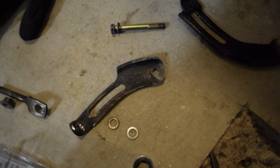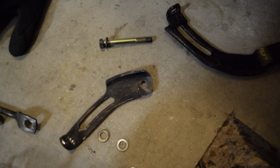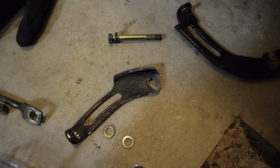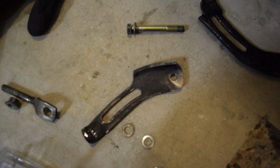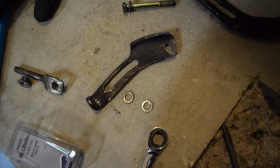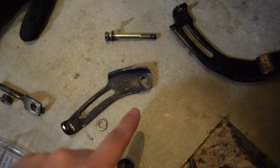It actually looks pretty good, and it works really well with the way that this alternator is set up, because the old alternator had the mounting point and the tensioner point on opposite sides, 180 degrees away from each other. But this one is offset to the side, so having it pulled downwards is actually perfect for tensioning it. I imagine that the actual G35 is pretty close to the way that this is set up. But I'll put it on the car and show you how it looks. It fits really well.